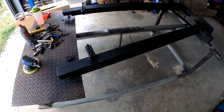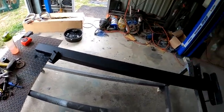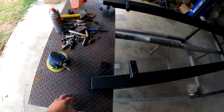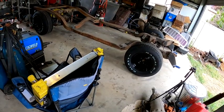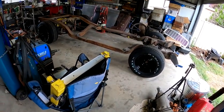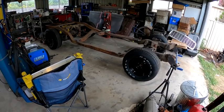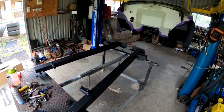It's the next morning. The rail adapters have cured overnight - really happy with how they've turned out. Going to bolt these to the underside of the cab, then sit it back on the dolly and put it back over that side. Swap the chassis back over, get all the suspension disassembled out of it, and start the process of bare-metalling it - smoothing out the welds, pretty it up. Just getting into bolting these chassis rail adapters up.